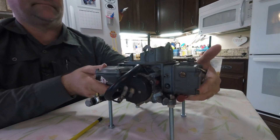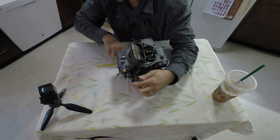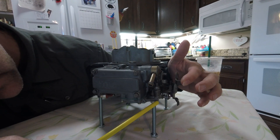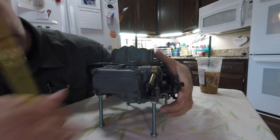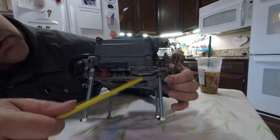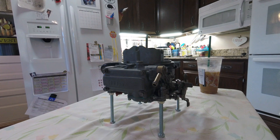Alright. So when your throttle goes forward, you'll see here — I'll turn it so you can maybe see. When you accelerate, see this here pushes this down and it rocks this part up. And that is where my leak is or was. Let's take one of the bowls off to give a better view inside. That may help some too.